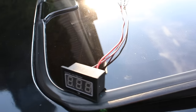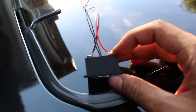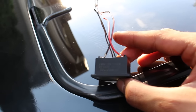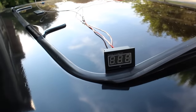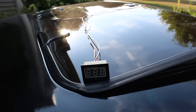Let's just get started with this install — super, super easy. As you guys can see, it's just two wires, positive and a ground. Red goes to positive, and this is going to go to a switched 12 volt source. Obviously your black is going to go to a solid chassis ground. I'm going to show you guys where I'm going to put my gauge. If you guys have a 240, this is going to be absolutely meant for you — it's going to fit up absolutely cherry. Let's just hop in the car and I'll show you guys how it looks.